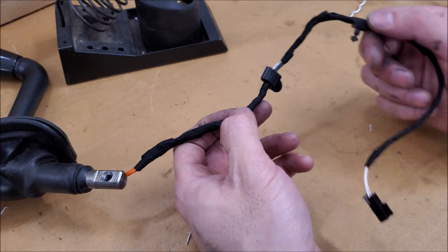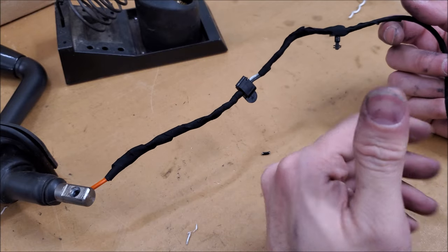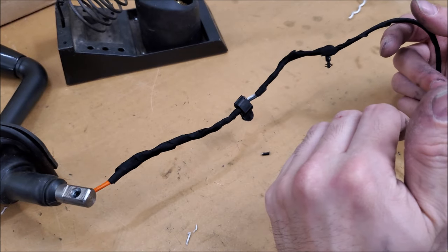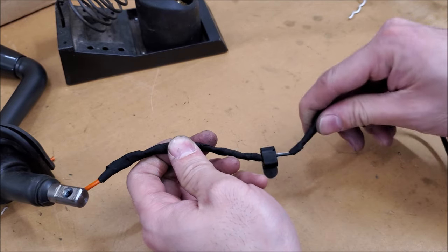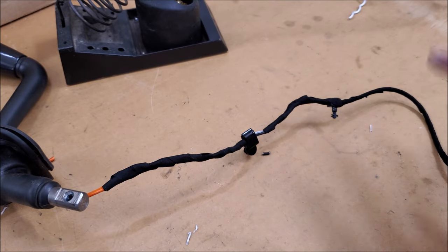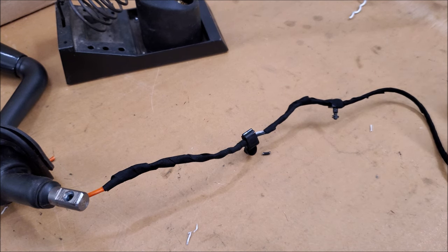The main thing is it's going to articulate now from the new, more durable wire. I'm trying to get my connections away, because we've technically added more points of failure in theory — now we have 1, 2, 3, 4 connections with the extension, as opposed to buying a whole new piece. But because we're articulating on the new, more durable wire, I think this is the better fix. If you want to do this, by all means do it this way. If you're not comfortable with it, go get the aftermarket piece or the OEM piece and just replace it. It took about 240,000 kilometers for my truck to actually experience the failure.